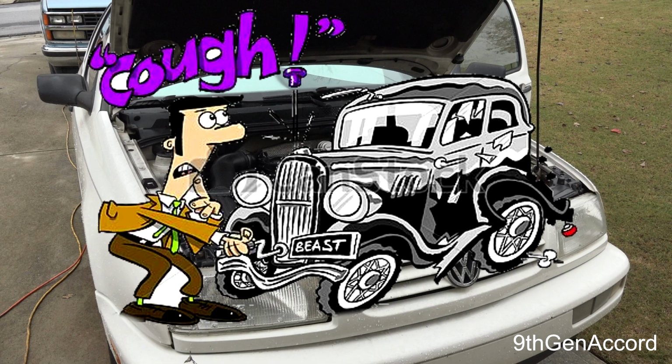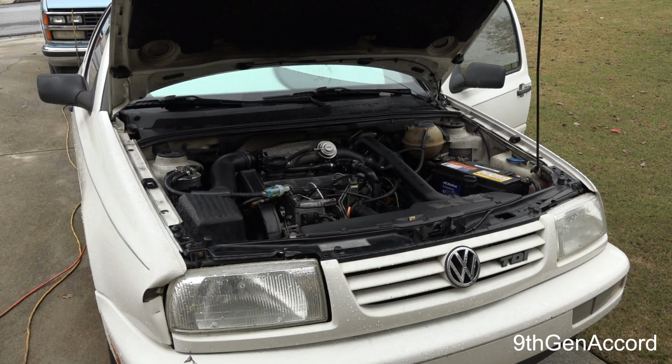This went on for about a month, and I noticed that I had a leak in the seal on the injector pump where the head is. So I replaced that, thinking that that probably was what was causing it. Now, I didn't know that there was another factor that was actually causing this, but it seemed logical that the injection pump would be losing its prime, and it would take a while to crank and it would fire over. So I replaced the seal.